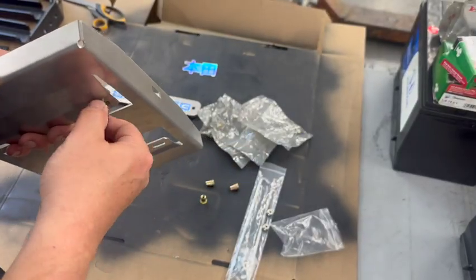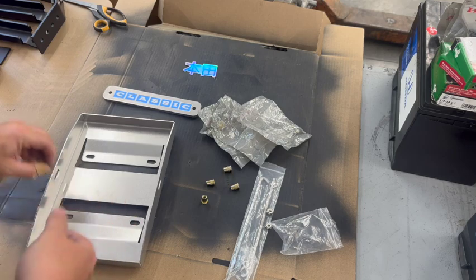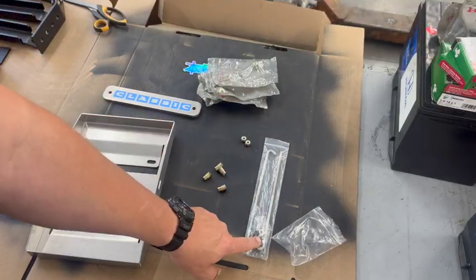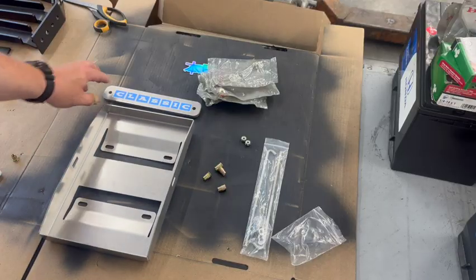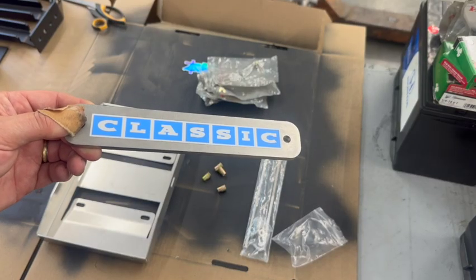So to summarize, the kit includes four rib nuts, four Honda flange bolts, two nylock quarter-20s for the J-hooks, eight-inch J-hooks (also stainless), and washers and toppers. That's what comes in the Honda Element 24F Battery Tray Conversion Kit.